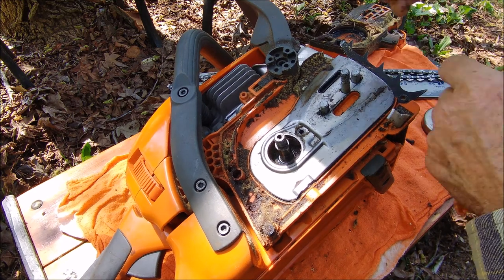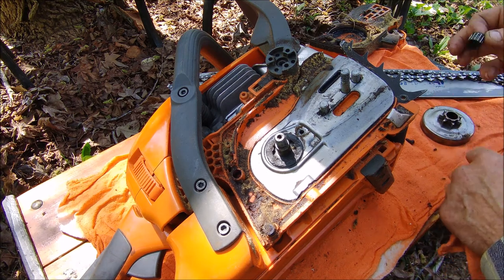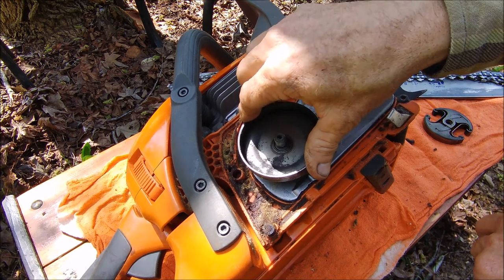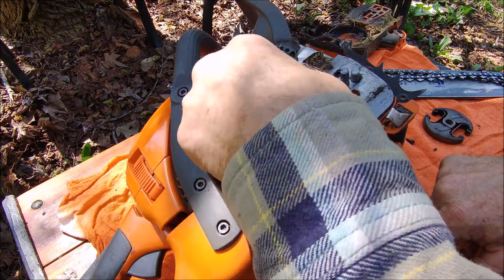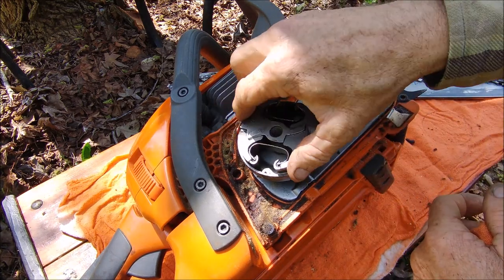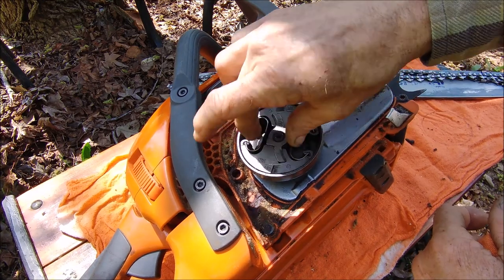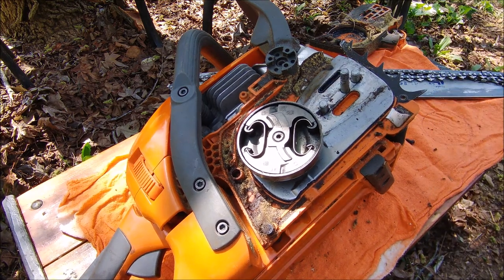Like I said, she uses right at a tank to a tank now. That's the drive bearing and drum — make sure it's flat and drops into that little inner gear, so make sure that falls in properly. Then you're ready to screw your clutch back on. Just give it a light tap to lock it on because it drives in the direction to tighten it.